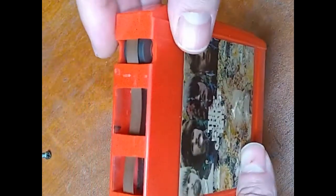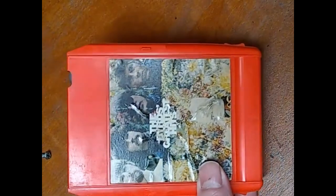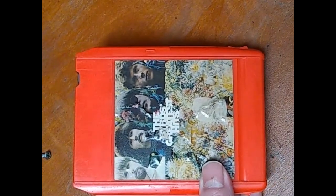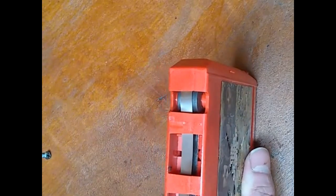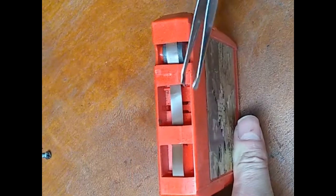With this style, it has a reel very similar to the one I just showed you. Often times, if the label is in really good shape and the customer does not want me to damage the label, unless I absolutely have to, I will just do a tune-up without opening this up. You can clean the pad area, remove the old pad, and clean the area up.